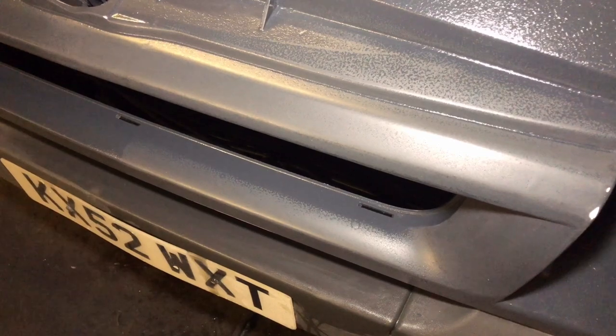So the van now has two coats of paint. I left it to dry overnight - it's been about 14 to 15 hours since I painted the second coat on. It should be just about dry enough for me to start flattening it back, getting a smoother finish on some of the areas. There's a few little runs and a few little bits and pieces which aren't quite perfectly smooth. So what I'm going to do is flatten the whole thing back, give it a third coat, wait for that to dry, probably leave it until next weekend, then give it all a proper final flatten down and polish her up and hopefully we should have our final finished product. As you can see, I've done a little test strip of flattening it down and you can see the difference - I've now got rid of a lot of the bumps and lumps.